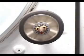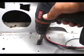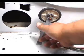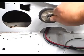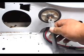Just push it in until it snaps in place. This is the way that the roller is supposed to be rolling. Replace this roller in the same manner you did the other one. The only difference is that you need to remove this bracket. And when you are done replacing the roller, you will need to put the bracket back on.